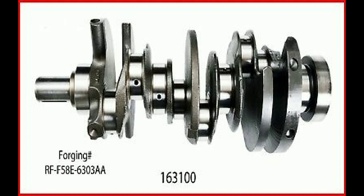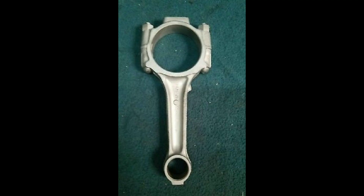Use an early Taurus windage oil pan. Minor mods have to be made to use 4 sets of studs and still retain the factory windage tray. A forged crank's main purpose is high RPM stability and strength. It will tolerate some outright abuse, but is not mandatory for 240+ horsepower unless you want to keep it wrapped up tight over 5500 RPMs all the time — then you must go forged. It is possible, and has been done, to modify a forged 3.0 liter or a 3.2 liter SHO crank to fit the Vulcan block for $800–$1000 in welding and machining. This will support almost 400 horsepower.